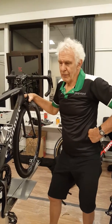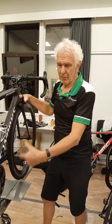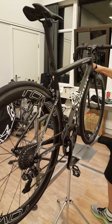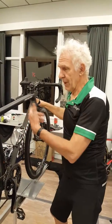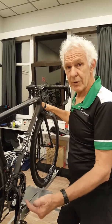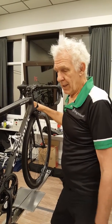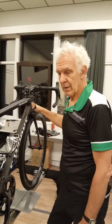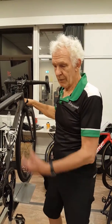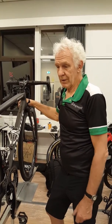There is a bit of difference. Obviously you have different manufacturers. The ones we're working on at the moment are Shimano with the Dura-Ace Di2, the electronic. But they also do Shimano with the mechanical, which is basically the cables — the outer and inner wires. They take a little bit longer to set up and you've got to watch when you're washing them, because water gets into the cables and you've got to make sure they're lubricated and clean.